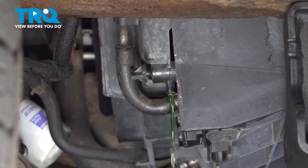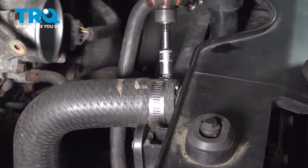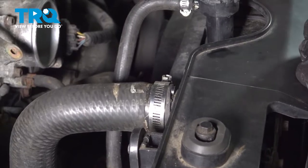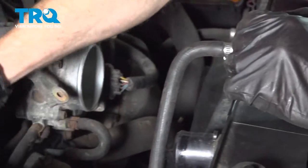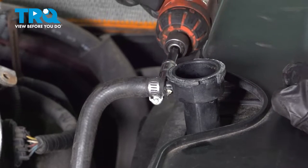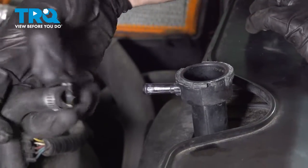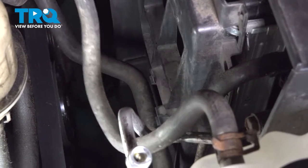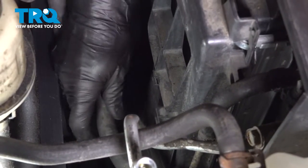While this is draining, let's make our way back up top. Now that we have the coolant drained, let's continue on at our upper radiator hose. We'll loosen the clamp just enough that we can remove the hose from the radiator and set that aside. Let's move along to the overflow hose — loosen the clamp, remove the hose. Once you have that off the radiator, continue following it down to where it connects into the fan shroud, pull it right out of place. Underneath that you'll find another hose pressed into the fan shroud — go ahead and dislodge that.